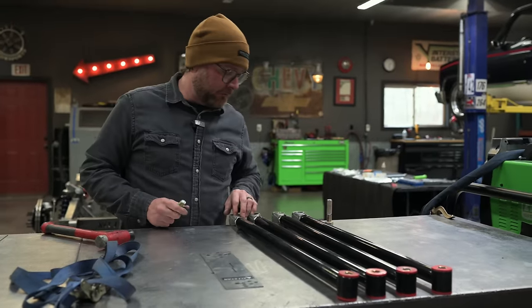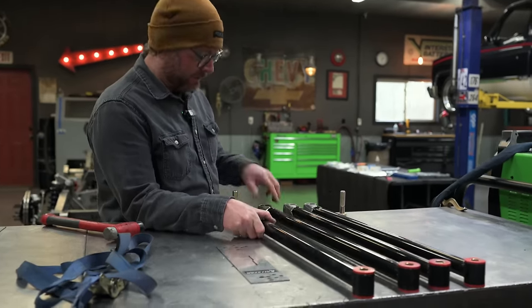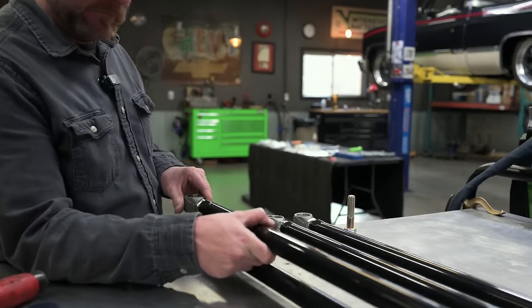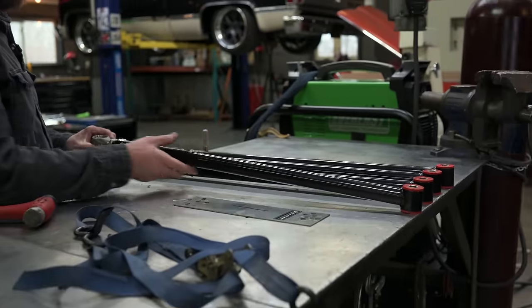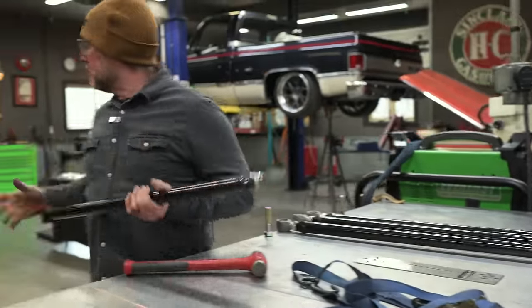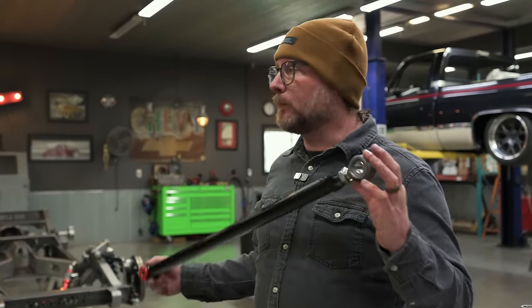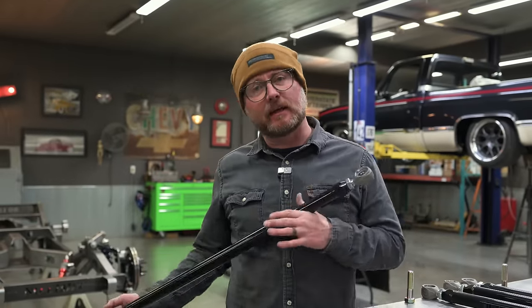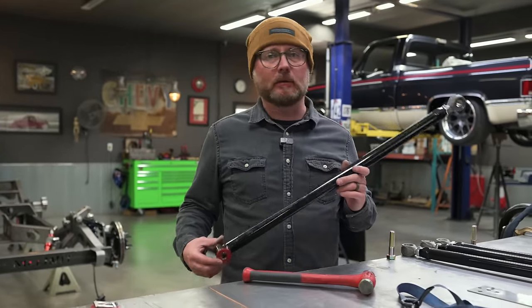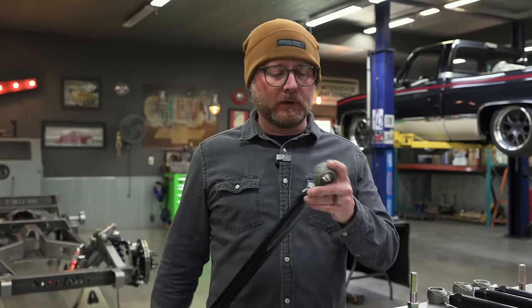I've got all four link bars matched up to the same length — you can do this at home, just stack them so they all line up and make sure you haven't got one bar that's two turns off or something. Ultimately this truck's going to get billet link bars and FK rod ends — he's sponsored by FK, so they're going to do a little collaboration with billet arms and his ends. We're going to put these in so that at least when he gets it out there, he knows what length to make the four-link bars. This is something we've come up with with No Limit over the past couple of years — using the RideTech R-joint.